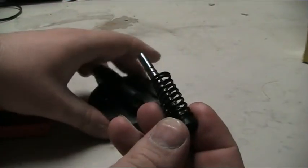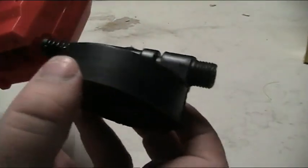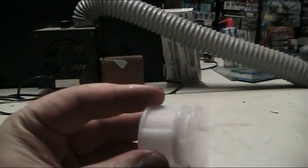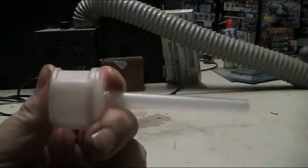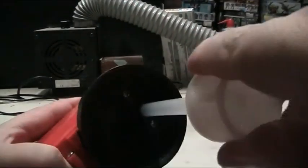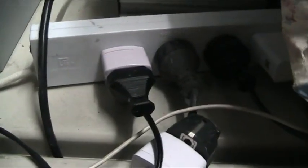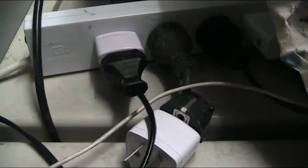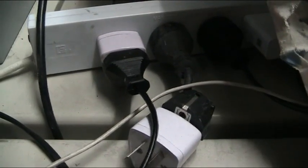Assembly is easy: the spring goes over the piston, then slide the whole mechanism across and reconnect it. The fitting can be a bit tight and awkward — there's a little cutout, push in, slip on, with quiet pressure, and re-screw. The filter and siphon click together, and the siphon clicks into the suction hole, which is the longer one. For electrical safety, do not disassemble any further than the black cap, and keep it like that until you discharge the power before re-opening.